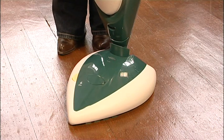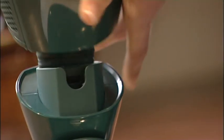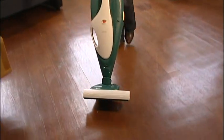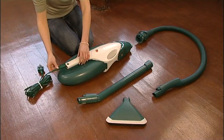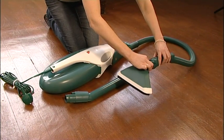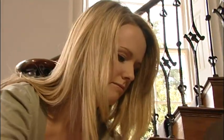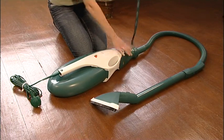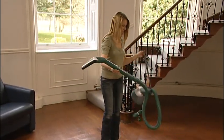The HD35 and Polylux PL515 can be attached in the same way. To remove the head, press the release button on the front of the motor body or the button on the side of the machine. The VK136 is now ready for use. For cleaning surfaces above floor level, first connect the electrical cable to the body of the machine. Then push the hose into the nozzle until it clicks into place. Push the accessory you want to use onto the handle of the hose. For extra reach, attach the telescopic tube to the end of the hose before adding the accessory. Release and extend the carry strap and attach it to the eyelet on the body of the machine. Adjust the length of the carrying strap to give a comfortable working position. The VK136 is now ready for use.